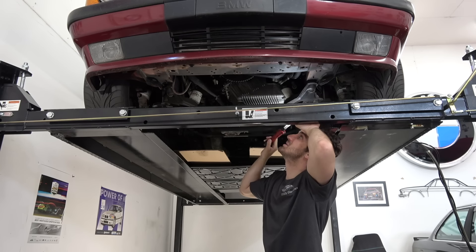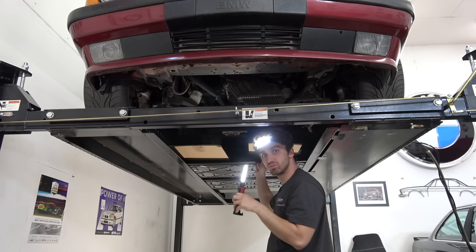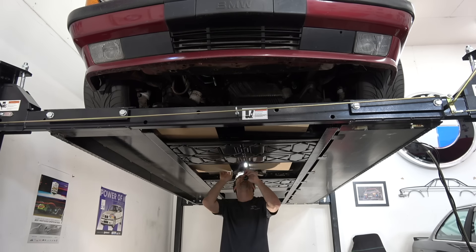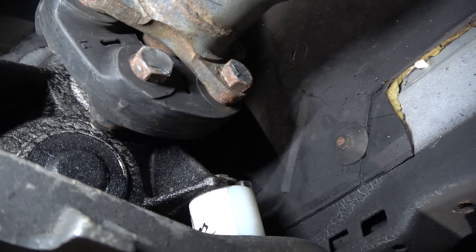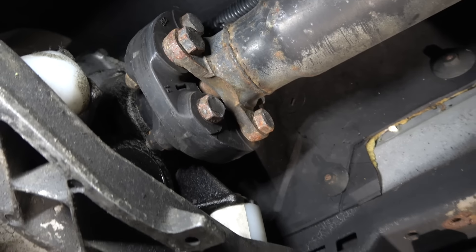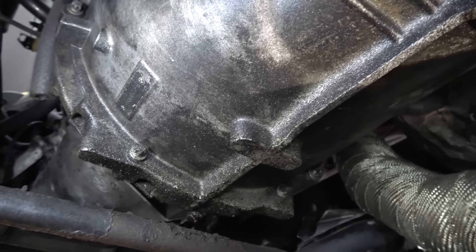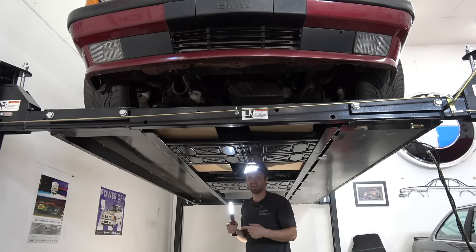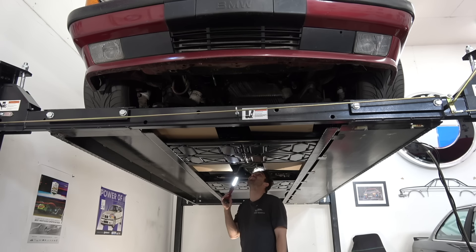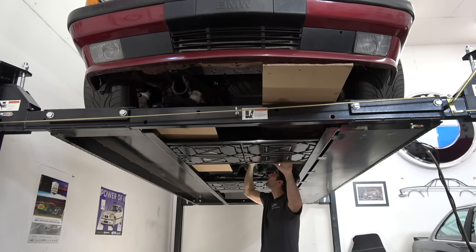Power steering pump is seeping. Belts look good. No coolant is leaking from the radiator — that's good. The transmission is very leaky. Looks like we've got an output shaft seal leak. Shift shaft seal is leaking pretty good as well. The one drivability problem I have has been the shifting — I sometimes can't get first gear. It looks as though it's just my selector rod being a little bit rusty. If that rod is rusty, it makes your shifting really clunky and nasty, and I honestly think that's what's going on here — it's a very old-looking selector rod. It can probably just be wire-wheeled up. The bushing for it looks good.